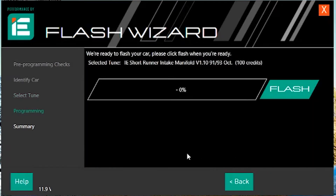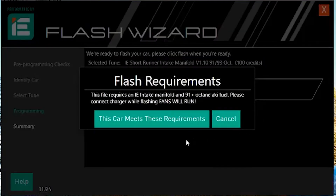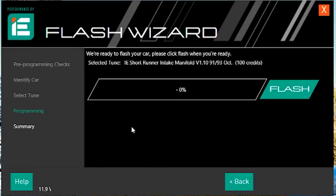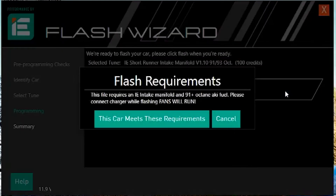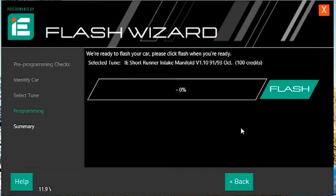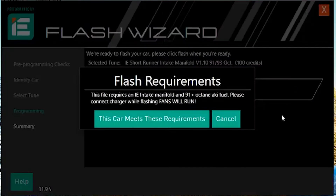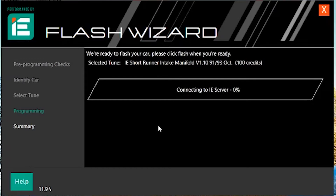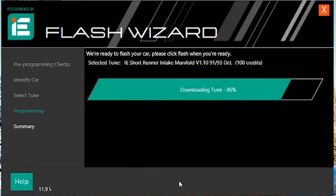The next page is going to have a little progress bar with a Flash button to the right of it. Go ahead and click on the Flash button. That'll bring up a screen that tells you what the requirements are for this tune. We have met these requirements, so go ahead and click that button. Then you can click one of the purchase buttons to purchase 100 credits — this is the upgrade cost going from the Stage 1 that I had on it previously to the Stage 2. It'll bring up your browser and you can go through the process there to purchase your tune. Then go through the same process again when it brings you back. It does take a moment for the credits to load, so be patient. Just hit Cancel out of that same purchase again, hit the Flash button, hit the Car Meets All Requirements button, and it should pop up with your available credits. Go ahead and click Purchase, and it'll verify your purchase and actually start downloading the tune and going through the process of flashing it to your ECU.